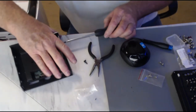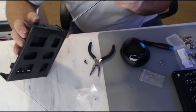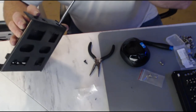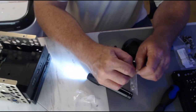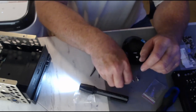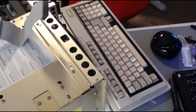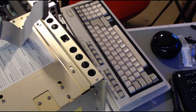So while I managed to film all this fascinating stuff here, putting screws in the adapter for the GoTek, I managed to fail to record the installation of the IDE2CF card adapter. But at any rate, there wasn't much to it. You just take the locking plate off of one of the expansion ports and install the IDE2CF adapter, and then attach the IDE cable to the I/O board. Still, would have been nice to have shown it. At any rate, here's the software setup that resulted from that.